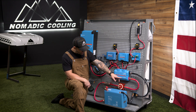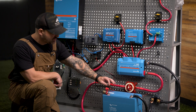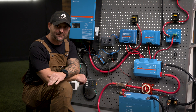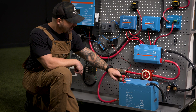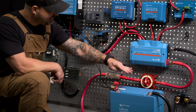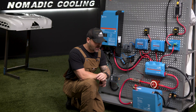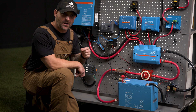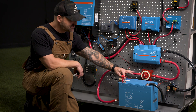All ancillary power wires — those powering the BMS and SmartShunt — currently come off before the on/off switch. These draw very little power, but if you store your system for a winter or long period of time, you may want to move those small wires to the other side of the on/off switch so that turning it off shuts down all parasitic loads. I've had instances where a van sat in the showroom for three to four months and came back with completely dead batteries because of these small parasitic loads.